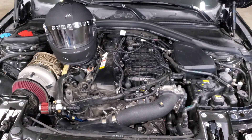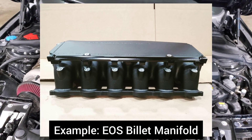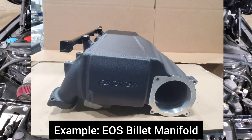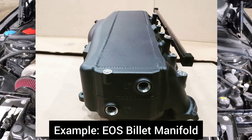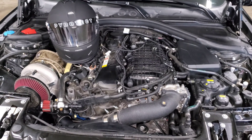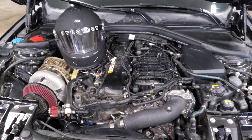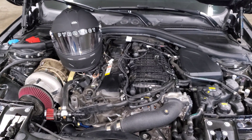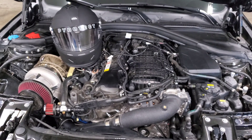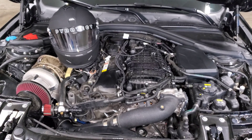The big change that's come out and what a lot of people are doing is upgrading their intake manifold — and because our intercooler is in the intake manifold, you're basically upgrading the intercooler as well. This is by far the best upgrade for all-around performance whether you're drag racing, road racing, autocross, or daily driving. It gives you the biggest drop in IATs and the most consistency with back-to-back pulls. The biggest drawback is the price, but if you're being competitive and trying to set really good times nothing will beat an intercooler upgrade. Some of them actually continue to drop IATs throughout your pull as more airflow goes over the heat exchanger — that's an incredible performance benefit.